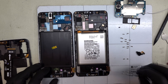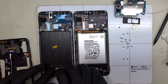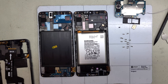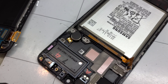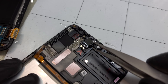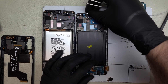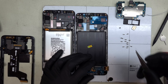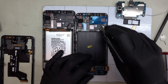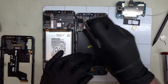I'll grab the new frame and start moving a few things over. There are a couple of components left in the old frame like the ear speaker and vibrate motor. Starting with the charging board, followed by this tiny little fingerprint scanner and two Phillips screws that hold it in place. Samsung usually has tiny pry points cut into the frame for removing the modular components — this is a huge benefit for anybody wanting to repair their own device safely and effectively.